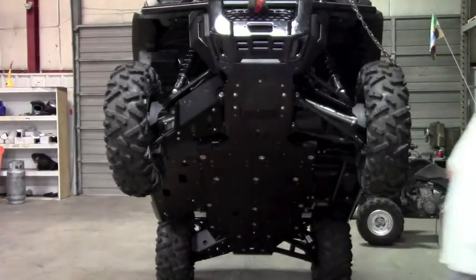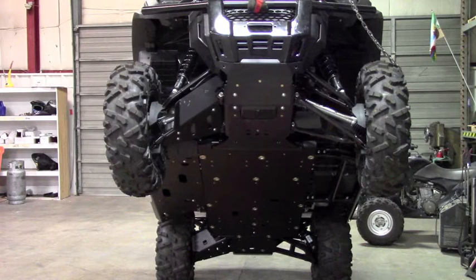And I'm actually going to drill a smaller hole just for a pilot, makes the drilling a little easier. Now that it's located and centered, your smaller drill bit will just follow along. Or if you have a 5/16 or an 11/32 transfer punch, you could punch it and then do it like I did with the inserts.